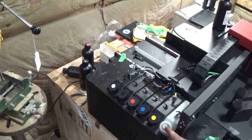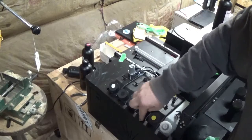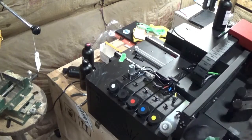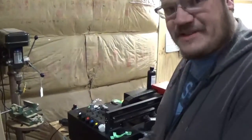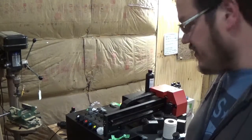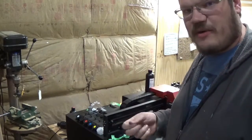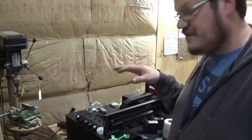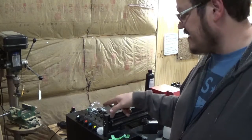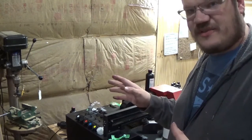You can see I have these all back in here. Now there's a sensor in the front of this little unit right here — we need to reset this. There's a sensor that tells you when you're running low on ink, and we need to reset it because my 250 milliliter bottles weren't even touching the sensor, so it thought we were empty completely — and it was printing. To reset this, we just need to turn the machine off and turn it back on, and we reset our sensors.